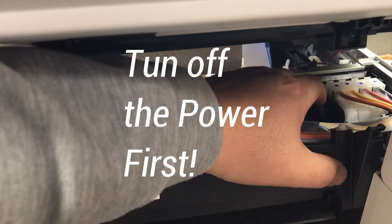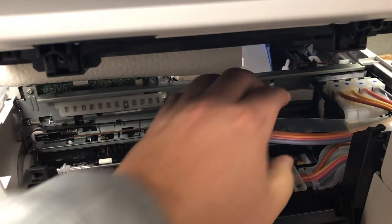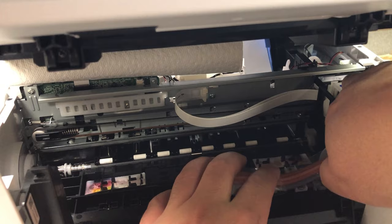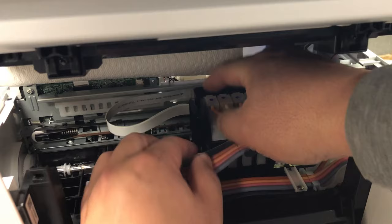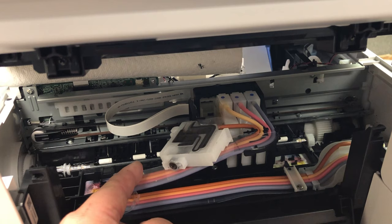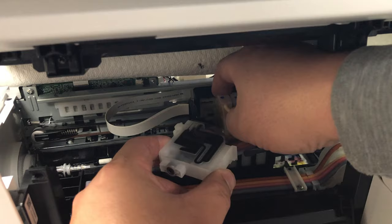I need to move the printhead to the middle — you can see it's locked. What I can do is turn that wheel four to six times counterclockwise. The trick is push to the right, then pull it to the left. Now I can use my finger to pull those tabs in, and then the damper can be removed. The damper seems okay — there is about three-fourths of ink inside each damper.